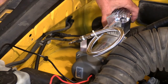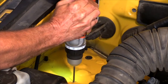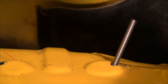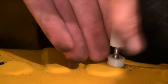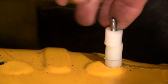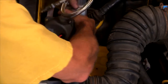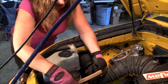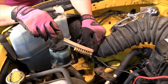Now I'll just mark the holes where we need to drill. Our fender well isn't exactly square and flat, so we're going to use these nylon bushings on the backside to level it out. I'm cleaning off the gunk and the corrosion from this ground wire here, and this is where we're going to ground the air compressor as well.